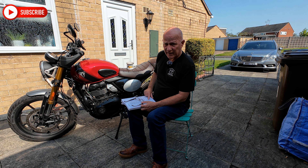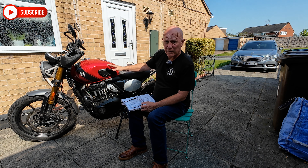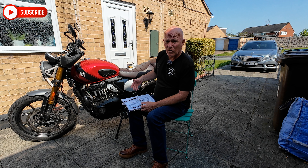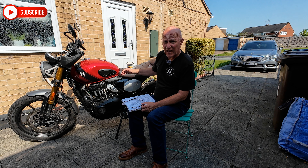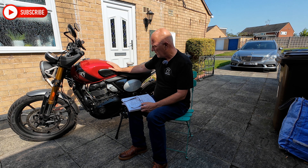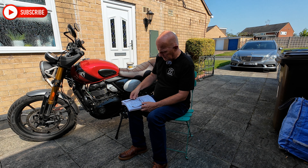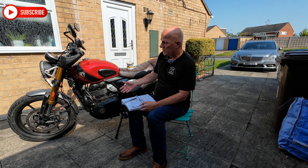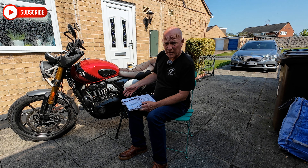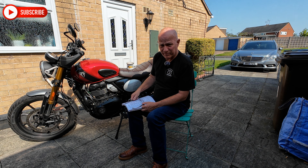Servicing is every 10,000 miles. This bike currently has about 2,700 miles on it and it's coming up to winter. I do intend to perform an oil change prior to winter — it's the cheapest way of looking after your engine and costs £50 at most. I'll create a video on that before winter really sets in. The service interval as I understand is every 10,000 miles.